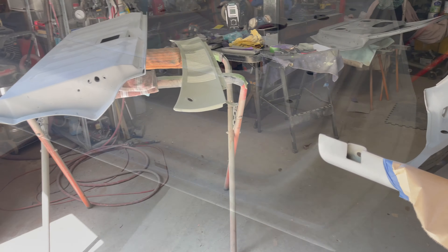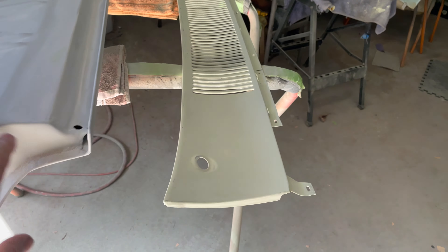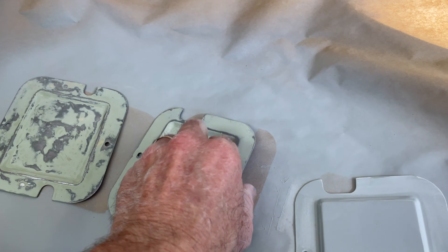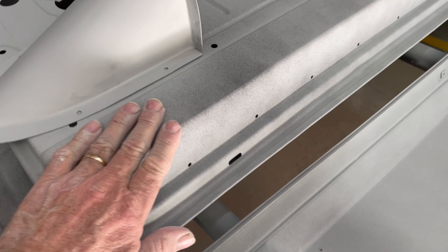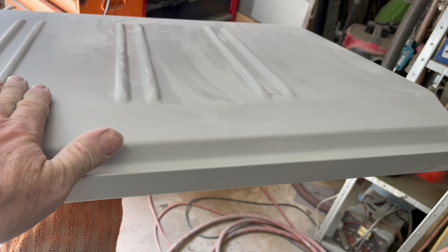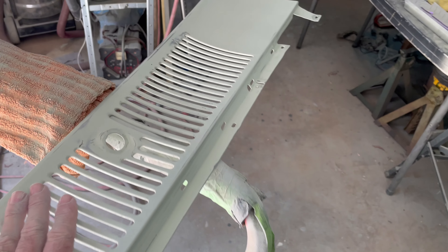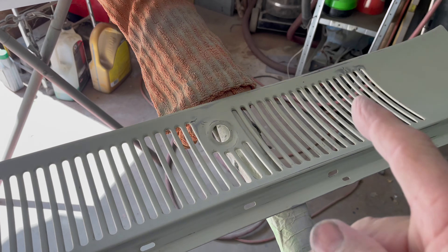Hopefully you'll see it in this video. I sadly thought I'd already finished the back of the tailgate but I hadn't — I only had it in epoxy primer. So I've been doing little jobs like this so they're ready. I'm going to give them another coat — they're just little cover pieces. I cover-painted them the other day. This is all ready for colour so I can sand it back wet, same with that door there, same with that side of the tailgate. But not this side yet — I'm about to put some grey primer on it.